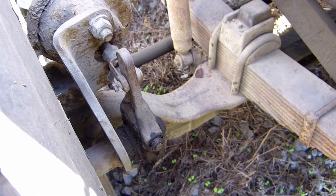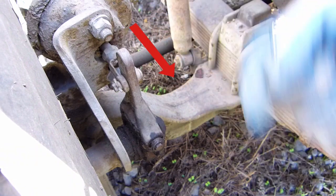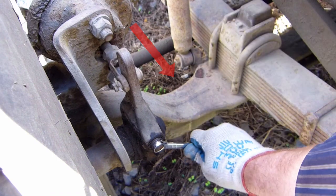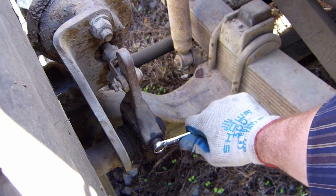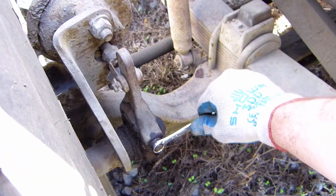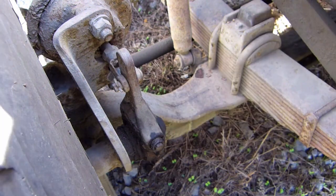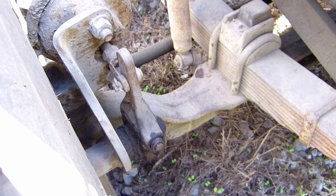After you finish adjusting this one, you go to the other side. Pry bar — make sure it's out of adjustment. We figure out which way the S-cam rotates for a brake application: think of it like a wrench on a nut. The push rod extends this way, so it's going to rotate in a counterclockwise direction. We put our 9/16 wrench on the adjusting nut and turn it until it goes tight. We can see that the S-cam is rotating in a forward motion towards the front of the vehicle, which is the correct way. The adjusting nut has gone tight. We check that the push rod will not extend out of the brake chamber — it has not, confirming we've manually applied the brake. We crank it back a quarter to a half a turn, ensure the locking sleeve is re-engaged, and confirm the push rod is within adjustment — the width of our thumbnail. And that's how you adjust a manual slack adjuster.